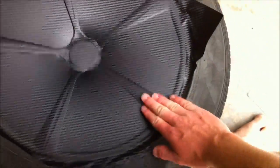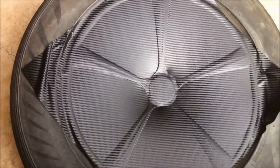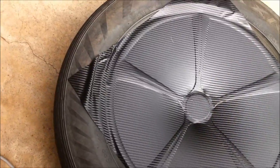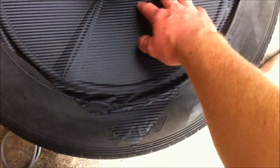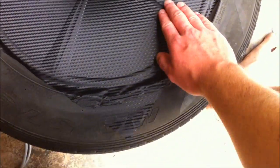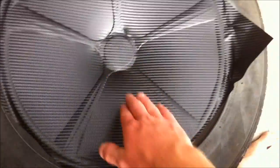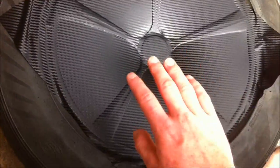Step two is just push it down on your spokes. If they're curved spokes and they're not flat with the outside of the rim, you use the hairdryer. It really helps. With the heat, instead of being more plastic, it just bends, and it's soft, it's stretchy. If the heat is too hot and hurting your hand, you push it down with the towel. You hold the hairdryer in front of it, heat it up, and then slide it down, sort of thing.